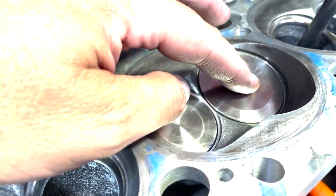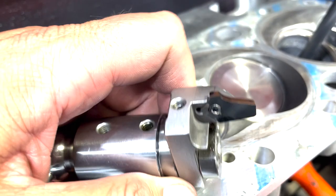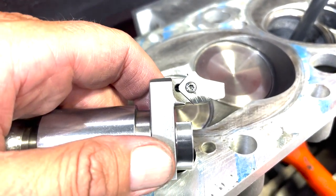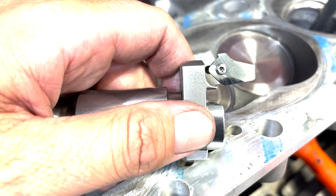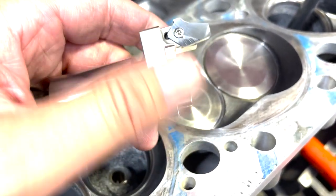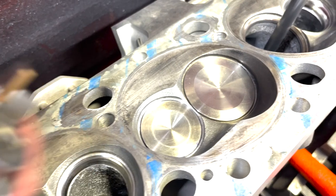I'm probably going to stick with a 45-degree seat on the intake, maybe go 50 depending on how things look, but I don't really want to open a big can of worms on this project. I've got a cutter picked out that I use quite a bit. How I decide on the profile is really a combination of experience and intuition — I couldn't tell you exactly how I make the decisions I do on this, but this is something I know works. We're not trying to get too complicated with this valve job if we don't have to. Now I'm going to cut these in the same fashion and we'll see how that turns out.